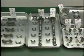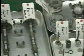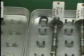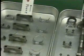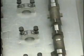Be sure to arrange all removed parts in the correct order to save labor and time in later reassembly, as well as to avoid incorrect reassembly. Place the removed parts on a parts stand or arrange them in order with a numbered slip on each part. Return each removed machine screw or pin to the part from which it was removed.